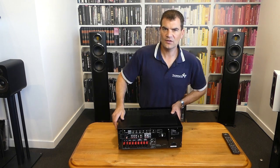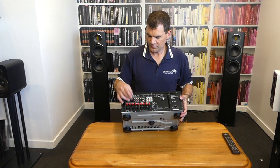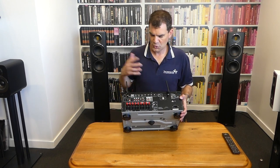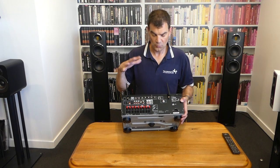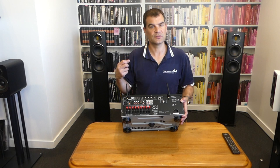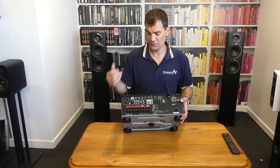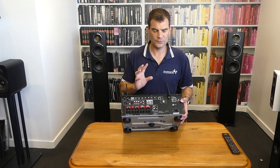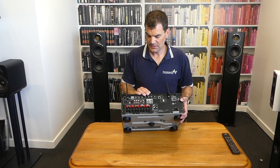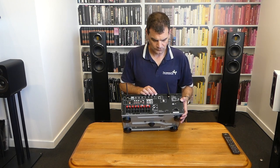Spinning it around, I guess, that's where the magic kind of happens. Tilt it up and have a look. Firstly, is the fact that it has 2 wireless Wi-Fi antenna. Now these also operate with the Bluetooth, because within MusicCast, of course, you can transfer to it and out to headphones if required. This runs dual band 2.4 and 5 gig. And it will also support wireless rears.